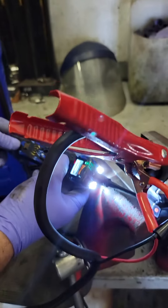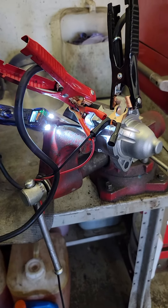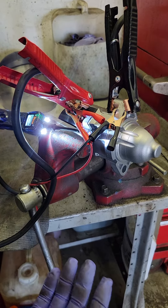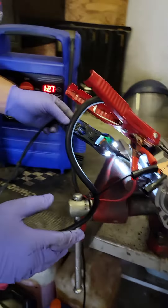Find the S terminal pin right here, then apply power and watch it — the starter should jump out, engage, and then spin. If it doesn't jump out, you have a bad starter. If it clicks, you have a bad starter.